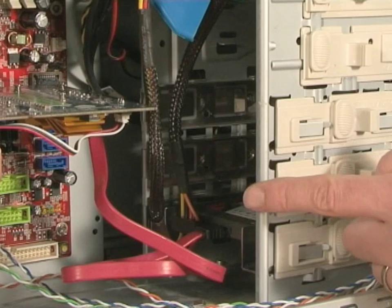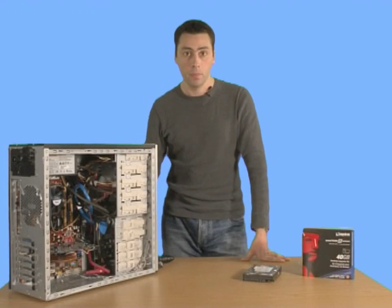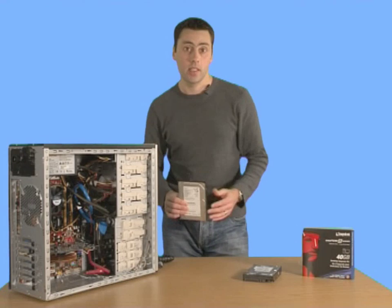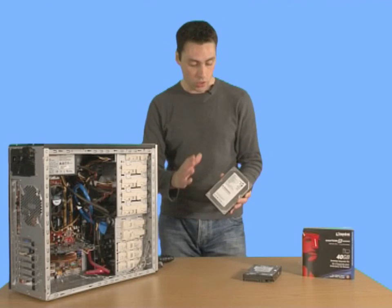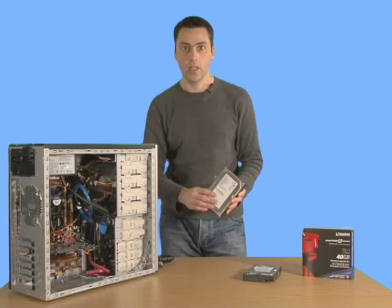You'll be ready to put the SATA power and SATA data cables straight back in. Now the drive is in place and both cables are connected, you're ready to reinstall Windows onto that drive. Or if you've removed an old boot drive and you want to clone it directly onto the SSD, you'll find that most SSDs actually come with some cloning software.